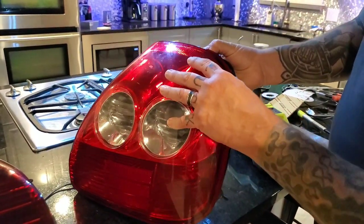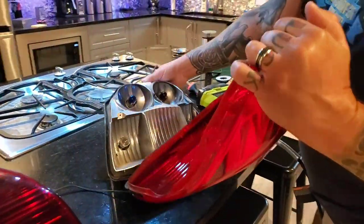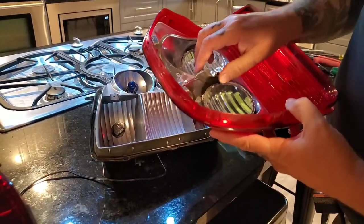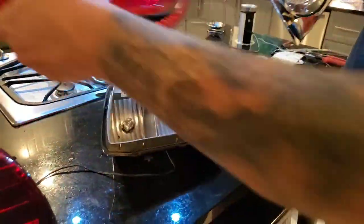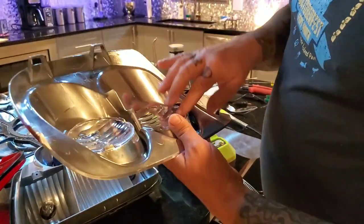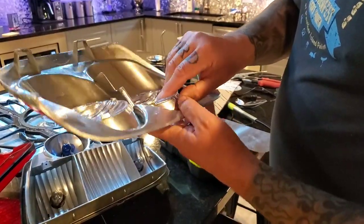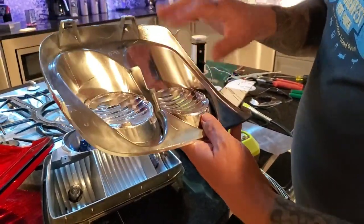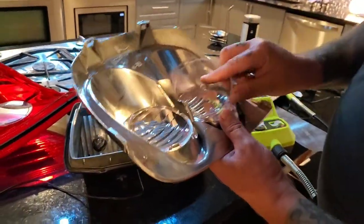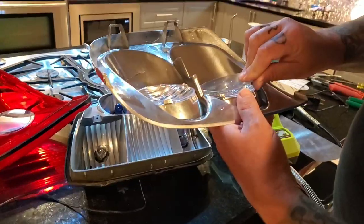So I've got a new lens. There are two screws that you're going to take out, then this comes out. We're going to pop these clear pieces out because, like Spider Lee said, if you keep them there it really distorts the light — it looks really weird. We're going to place the LEDs on the plexiglass in place of those clear pieces. I hot glue it and then use silicone to hold it in place permanently.